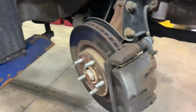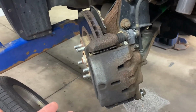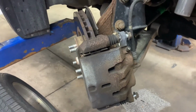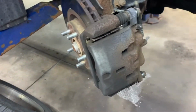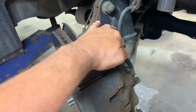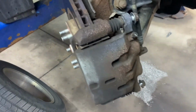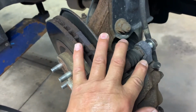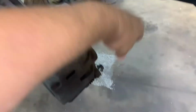Okay, you got your tires off. Hopefully you have the ignition key in the accessory mode so you can turn the wheels back and forth, not in a lock position. So you can turn it all the way to the right. You get a 17 millimeter socket and loosen up your caliper bolts. They shouldn't spin because these got a little notch here that locks them in on the slide pins. So take them out.